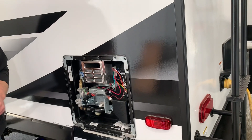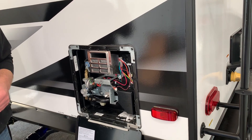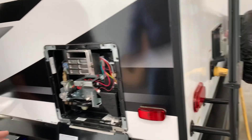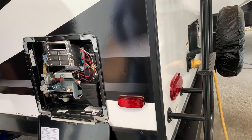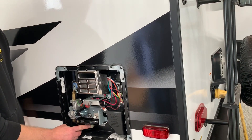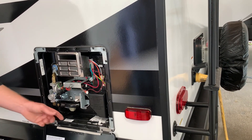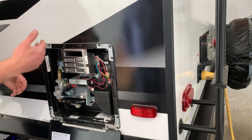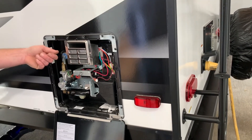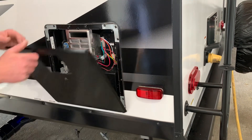Are you familiar with winterizing a camper? Do you plan on putting antifreeze in it, or do you expect to drain it? You've got a cap right here to drain the water heater — just take that cap off. I believe it's an inch and a sixteenth if you want to use a socket. A lot of times when you take that cap off, it's not able to vent, so it takes forever to drain. Pull that pressure relief valve and then it'll drain.